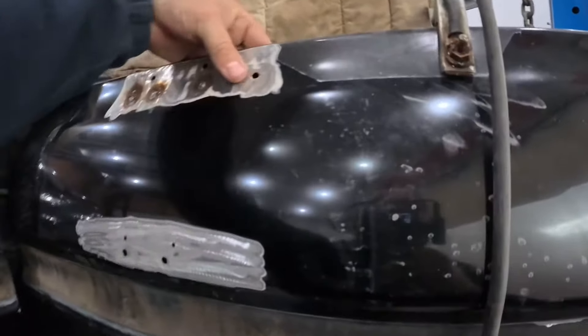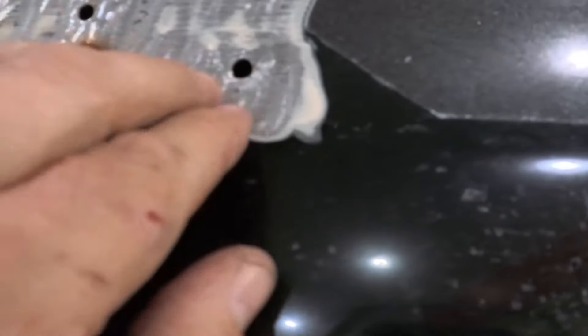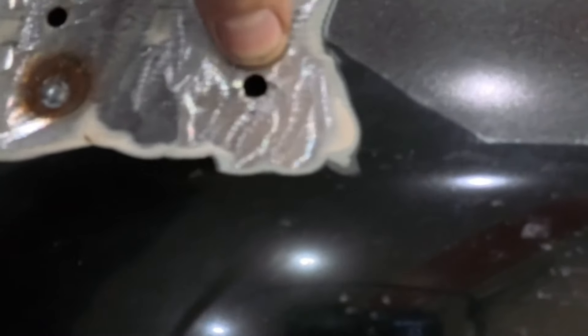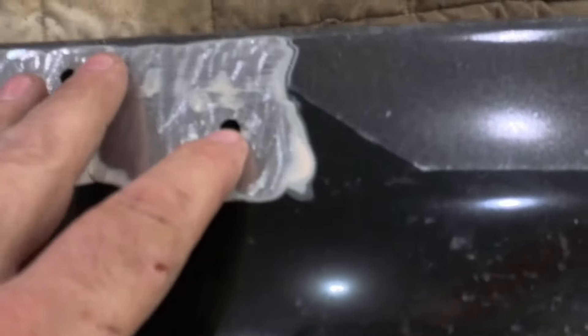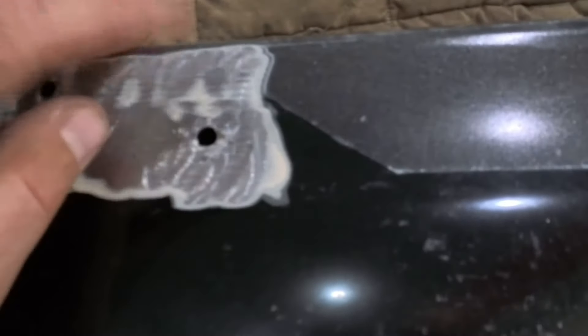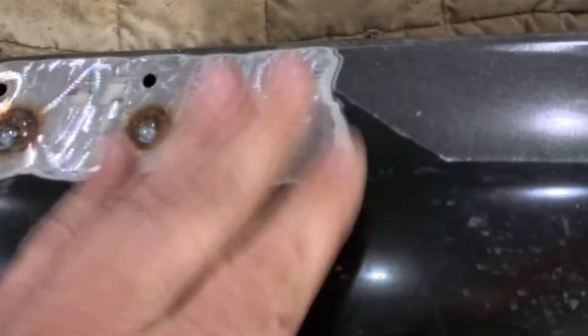This is an old door with some metal to it. What I do on these old ones: you can't go right at the hole and just start welding — it's just gonna burn a big hole. What I like to do is start a tack on the face of the door, probably do about three tacks, then come in at an angle with the wire and try to weld it down to the bottom. You want to get the weld down to the surface of the door so when you grind it smooth it's clean. If you weld all around and up on the door you're gonna grind it all off and probably just open the hole back up again.